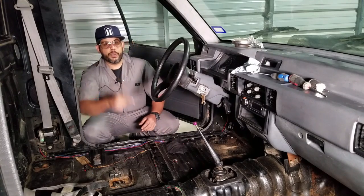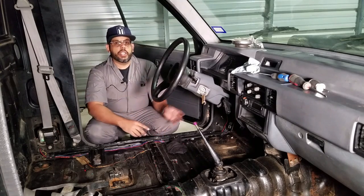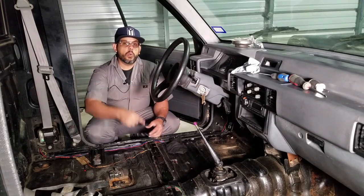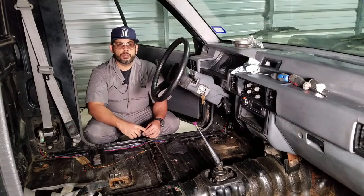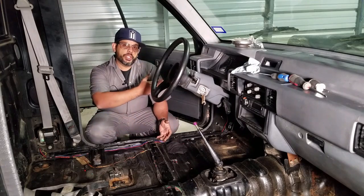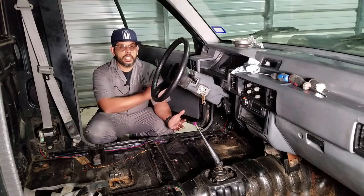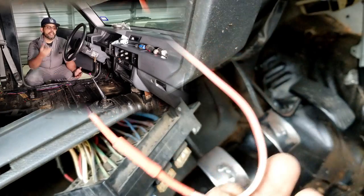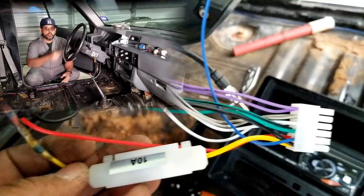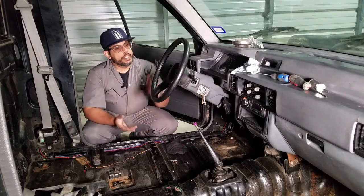At the end of part one, the radio started turning on and off on its own even when the key was off. I took it out and checked all the wiring. The 12-volt ignition wire — the white and blue wire — had five or six volts running through it, keeping the radio on. The 12-volt constant red and black wire was leaking voltage to other wires. I cut it from the fuse box, bypassed it, and ran a new wire directly to the radio. Now the radio works with the key and turns off. Finally working!